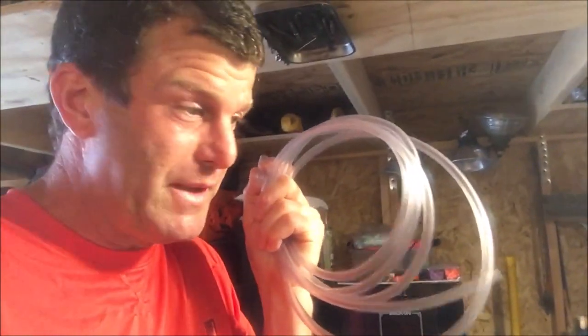I may have one of these. I used to anyway. So I'm going to replace it and see how that works. I didn't have any of those hose clamps — I probably got rid of them when I moved into the RV. But I got some tubing, so I cut a short piece. I'm going to cut a slit down it so I can open it up and slide it down over that piece of copper tubing inside that hose clamp, hopefully. Then tighten the hose clamp back up and maybe that will get rid of the noise.